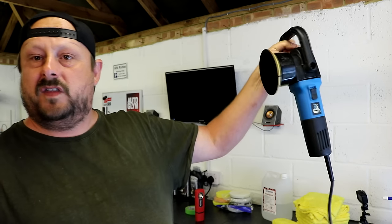That is expected. You're not going to go in with a one stage abrasive on heavily swirled paint with the least aggressive type of machine polisher, the DAS 6 pro dual action polisher, and instantly make flawless paint. So that's the one thing I want you to take away if you're doing this for the first time. Expectation. You can drive towards perfection, guys, by doing set after set. When you make the decision you're going to do more than one set, then immediately the one step, one stage, one hit polishing approach is obviously not going to give you the best results.